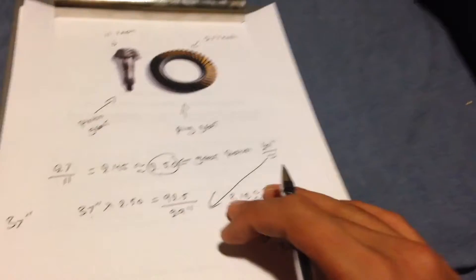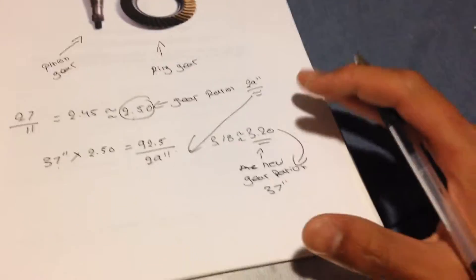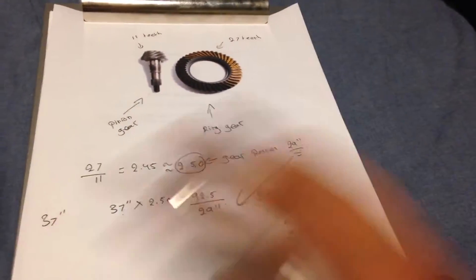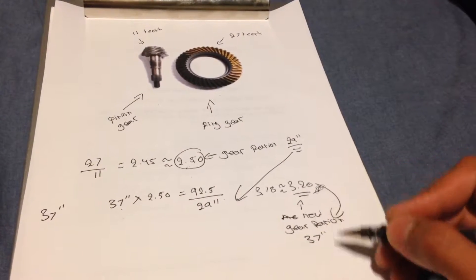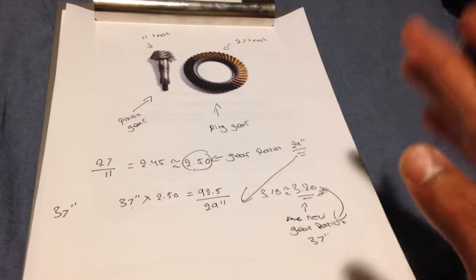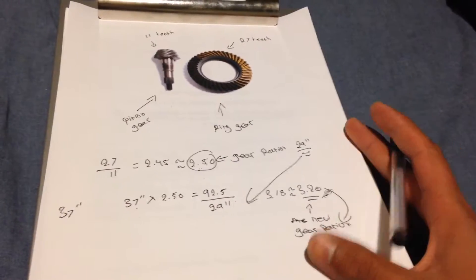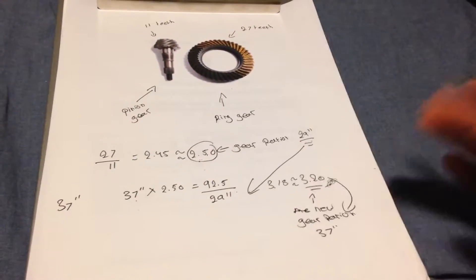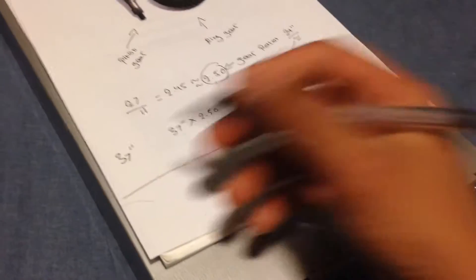So that's the correct way to check your gear ratio for 37-inch tires — you're going to need to run 3.20. This works for any truck: Jeeps, Fords, Chevys, Dodges — anything. With this new gear ratio, everything goes back to normal. Your shift points are going to be okay, your overdrive is going to be okay, your fuel mileage should be okay, and you're not burning out your gears or overheating your torque converter from running the wrong tire size.